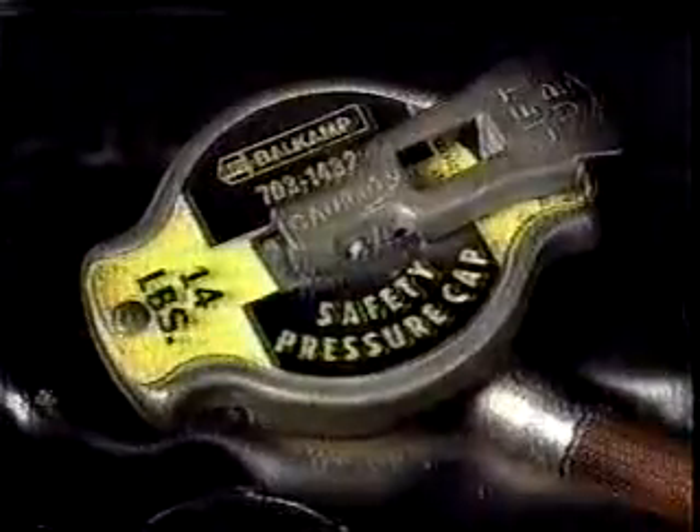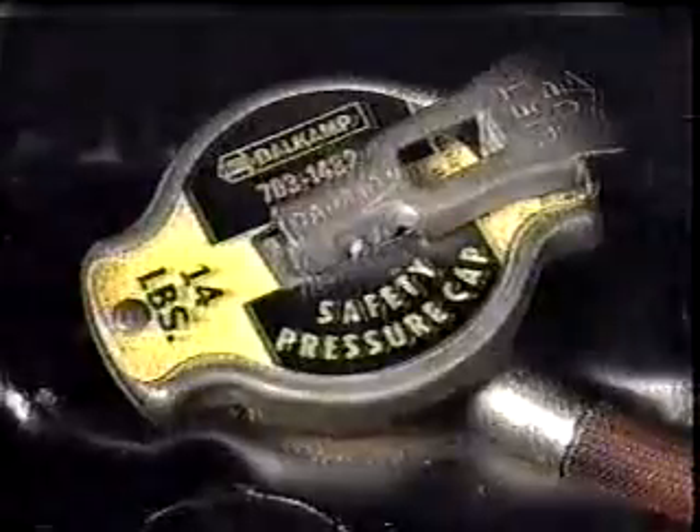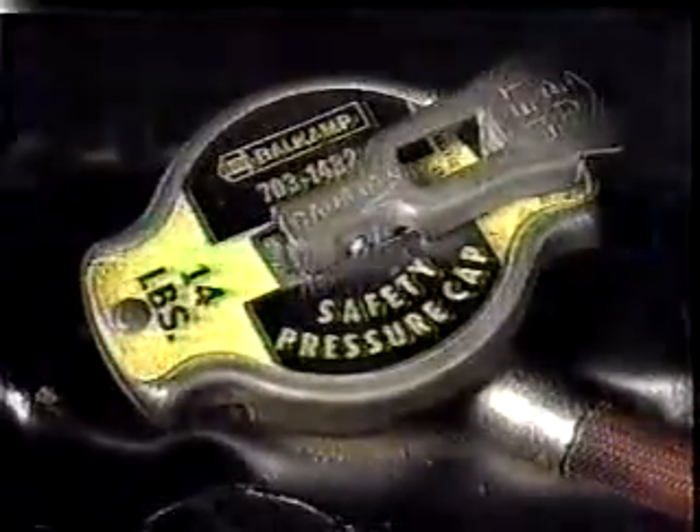While the car is running, the engine produces a great deal of heat. In most cars, this heat is carried away by a liquid cooling system, part of which is the radiator. The radiator cap keeps the fluid under pressure in order to raise the boiling point and prevent overheating. Pressurized radiator fluid can be dangerous. If the radiator cap is removed while hot pressurized fluid is in the radiator, the fluid will boil and erupt out the top. Never remove a radiator cap while the engine is still warm. Wait until the engine has cooled to check the fluid level.